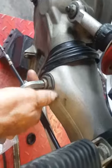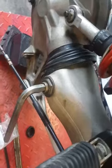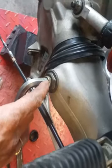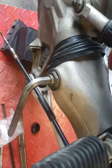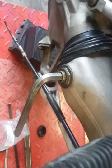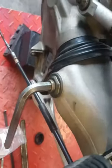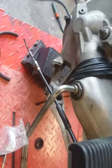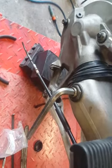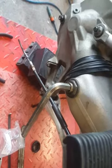When this is on, I Loctite that thread too, and of course you have to heat those and kill the Loctite with heat before it'll undo. And this lock nut, this inside here on a bearing, if you're putting it in a needle roller bearing, only gets torqued up to about 4 or 5 foot-pound. You do it with an inch-pound torque wrench, but this nut here, this lock nut, goes down to about 70 or 77 foot-pound. So the lock nut and the home pin on the other side both have very high torque values to lock those pivots very tightly, because you can just imagine the kind of shock load that they are taking.